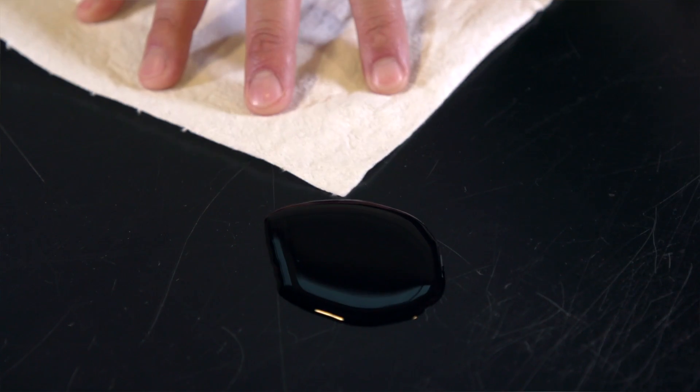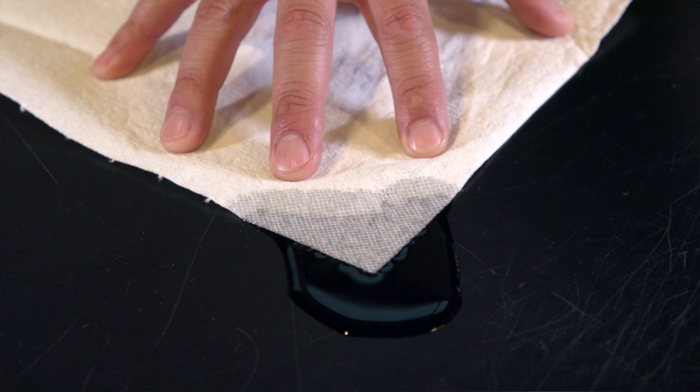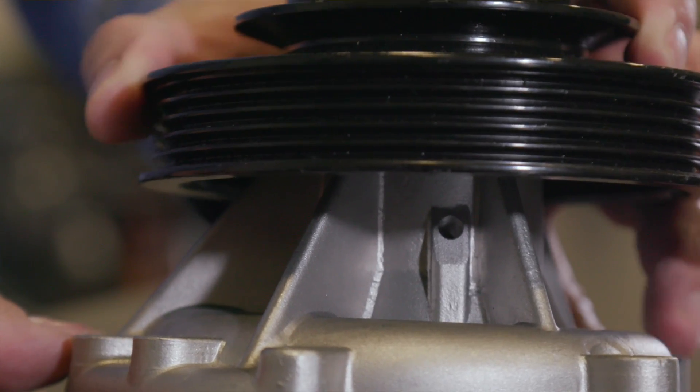When an engine is started, the water pump moves coolant through the system. Coolant is drawn into the seal surfaces by capillary action — like when you spill water, touch the corner of a paper towel to the spill, and the towel draws it in. As the coolant passes between the seals, it has to go somewhere. The weep hole is there to allow a small amount of coolant to drip out.